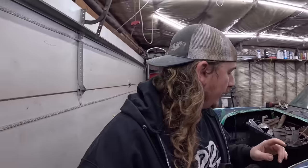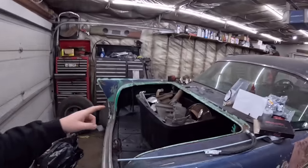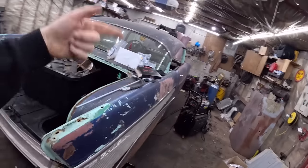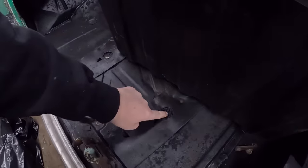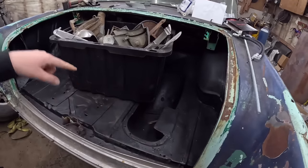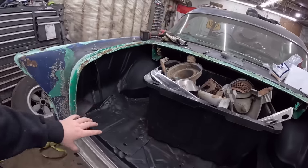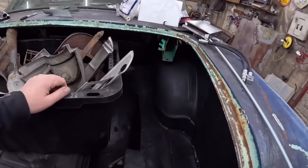Now where we left it, we were going to change the fuel tank. I think while I'm under there, hating life already, I'm gonna grind my welds, really grind into the saddles of the axle, and re-weld it, might as well do it now. Then the fuel tank's really held by two straps, and it uses carriage bolts. I don't know if you can see in there or not, but we're just gonna use all thread rod and some nuts, because that we have in stock. Replace those, dump that out, new one in, that'll be super easy. New O-ring on the filler too. Man, look at these wheel tubs. God, that looks good.